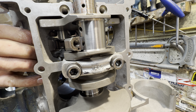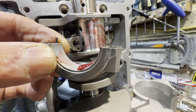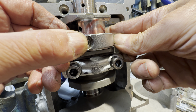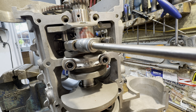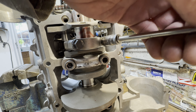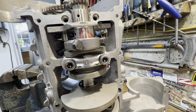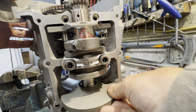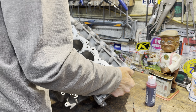This is just a case of pushing the piston down by hand until it engages with the crankshaft nicely. The cap slides on nicely engaging two dowel pins, then I can replace the two bolts and tighten. I do them up hand tight for now because I'll be torquing them down later on. I check the crankshaft moves freely and it does, and the piston goes up and down the bore, so that's a good thing. I do this at every stage to check for binding and tightness.